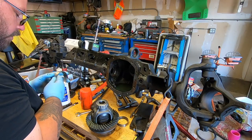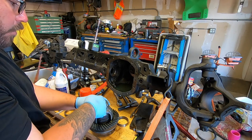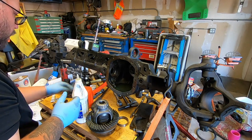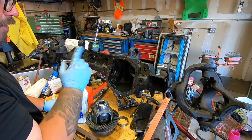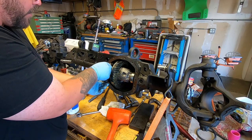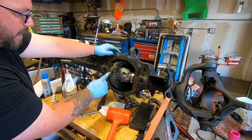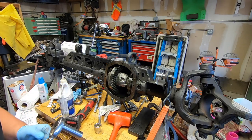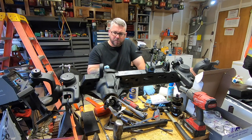Now it's time to install the carrier altogether. First thing I'm going to do is pour some oil in here and spin it around to make sure it's very well lubricated — flip it over and do the same thing to the other side. Then I'm going to go ahead and start my bearing caps, making sure they are orientated the way they need to go in — my upside-down A is my upside-down A and my sideways A is my sideways A. According to the instructions, we're going to torque these down to 60 foot-pounds. And with that, it should be a done deal.